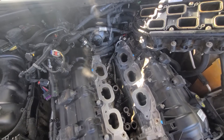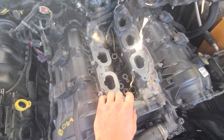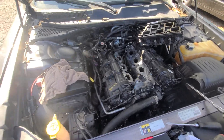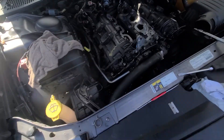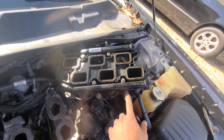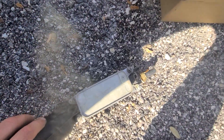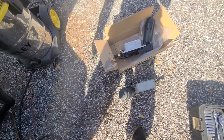So if you're seeing a leak between your engine and transmission, most probably your O-rings on the oil cooler assembly have gone bad — get this one replaced. It goes back together easily. The intake comes off with five 8-millimeter bolts. The lower intake manifold with injectors also uses 8-millimeter bolts all around — just throw it to the side. The oil cooler itself is held with inverted Torx 8-millimeter bolts as well — pop those off and replace it.